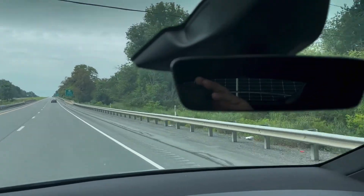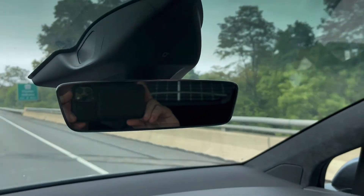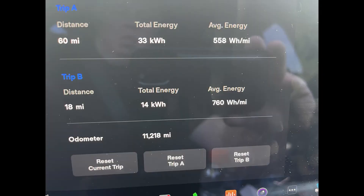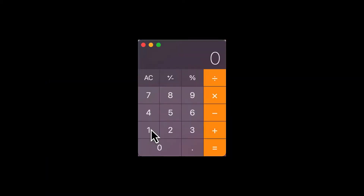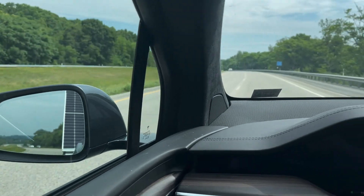I made the same trip at 60 miles per hour — I went low-tech, filming by hand — and I got 760 watt-hours per mile at 60 mph, so I lost some range. 100 kilowatt-hours divided by 760 puts me at 131 miles of range if completely full, though I would never take it that far.